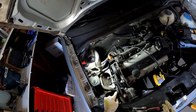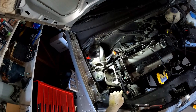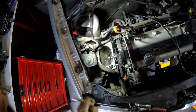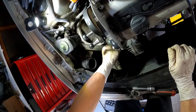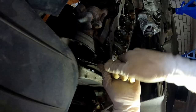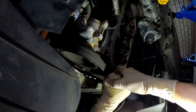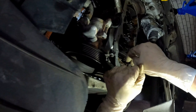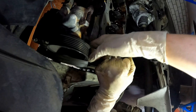This one will keep in place. Now that I'm done here, I need to get access to the pulleys at the bottom — for that we need to lower the engine a little bit, which I already did. I need to adjust it and get access to the tensioner down there in order to remove the belts. I forgot to mark this one — very quickly, there you go, a free tattoo. Now I need access to this tensioner here, which I already have, and I need to remove the belt.